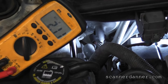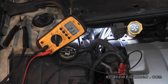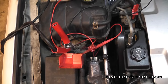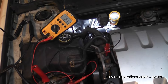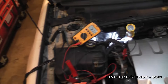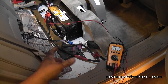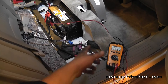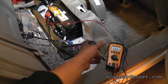We had four volts there — we'll call it two because that's where we are now. Next step was to go toward the battery. We have a voltage drop problem to our box, that's why everything is going crazy here. My ground connection is still on the block. So we go inside the car, remove the rear seat, gain access to the battery, and do some voltage measurements back there. We have 12.4 volts. My ground location is my main cable where it goes to the body of the car, and my positive is on the battery.